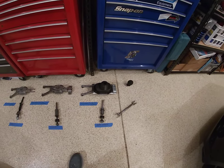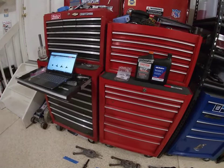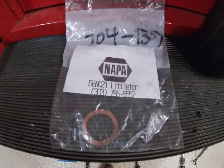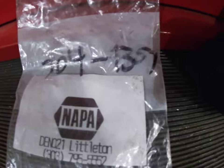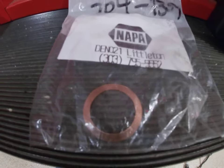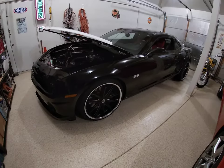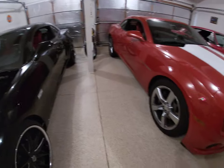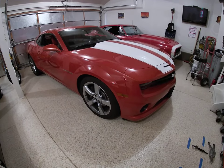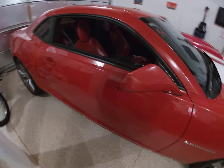Going back to consequences — the MGW is great, but when fall comes around that notchiness can be an issue. It can be fixed, believe it or not, with a trip to your NAPA store: part number 704-1357 — two copper washers. This is part of the anti-venom mod. The Tremec TR6060 transmission was installed in Camaros, Corvettes, Challengers, and Mustangs, so a lot of people run this transmission. You'll be able to find other videos online that show you how to install those washers.